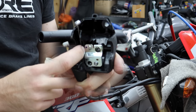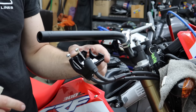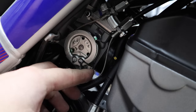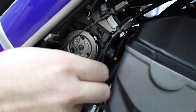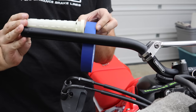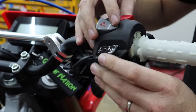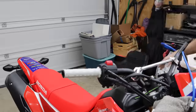Here's where our locator tab is. Some people say just Dremel it off and put electrical tape there, but I prefer to use the locator tab, especially on the throttle — last thing I need is the whole housing rotating so I lose throttle control. So I'm going to add those holes to the new bar. Disconnect the cables for now — don't worry, they're not hard to reconnect. We need to do a dry run first: stick everything on temporarily to figure out where we want the housing sitting. Put a little tape on the bar here — this will make sense in just a moment.